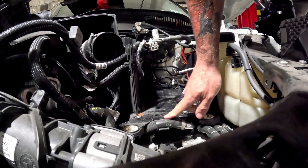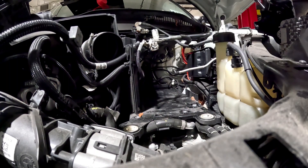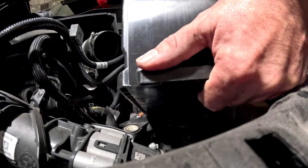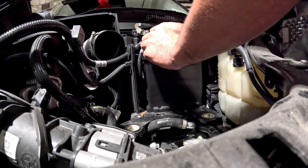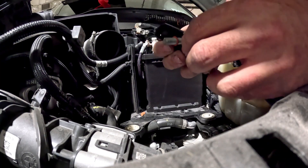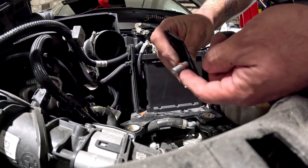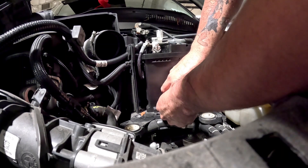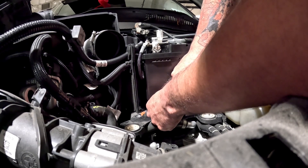Be careful of the coolant hose — it may be in the way but I've never had a problem. Push in positive, negative still off. Make sure that little rubber band is still on the bottom. Start the bolt by hand because I've seen people strip them out.